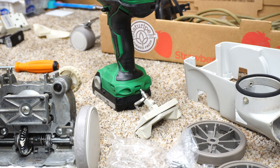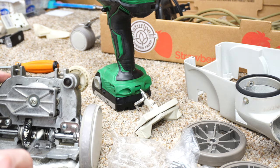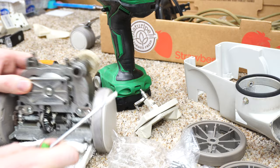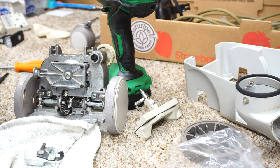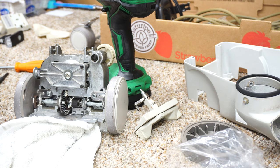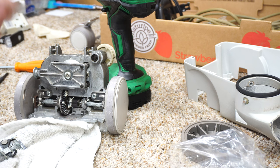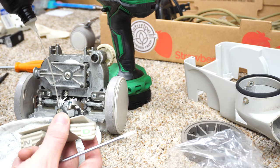The next part that needs to be greased are the normal parts inside the transmission - the cam area right here gets greased, and of course this little finger which has a little bit of wear but it's really good. It's kind of amazing but not surprising - I have found that the G3s are just a little bit better made than the newer Kirbys. I'd put the G4s in that category too - G4s are a little better made as well. But something happened when I got to the G5 and the quality and some of the changes just were not as good. Put all that back together and just a little drop of oil right there keeps that thing not only from rusting but keeps it running smooth.